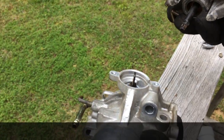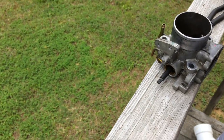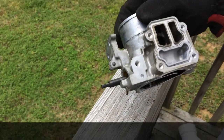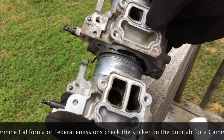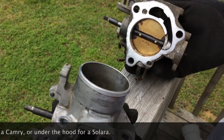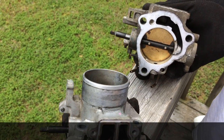That's what was causing the P0505 code in this car. If you have the wrong unit, it doesn't matter if you've got a brand new Toyota idle air control valve — it's still going to code out because the computer is looking for a particular type of airflow in its programming. In this case the computer wanted the small federal orifice but was getting the larger California one, and that's not going to work with the installed firmware. That was the fix — I hope this tip helps if you have a stubborn problem like this. Thanks for watching.